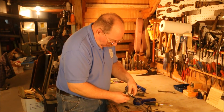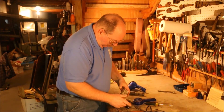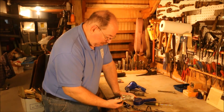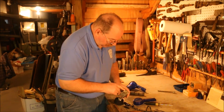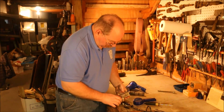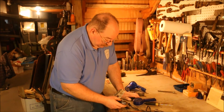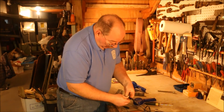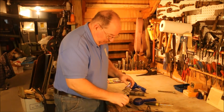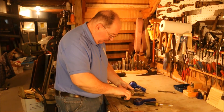Checking out the circuitry, I've got a high and a low setting on it, so there must be something in here that turns on or off one of the elements. Is there actually two elements grouped together? Yes — there's a large element and a small element. The small element has a resistor on it, and the large element appears to be a straight-through — gets juice right from the switch. I'm going to leave these wires because they're color-coded on the switch. I know these two go to the motor, and I don't need the motor on the heating elements.